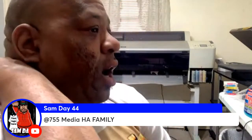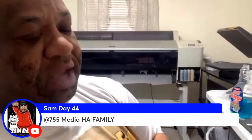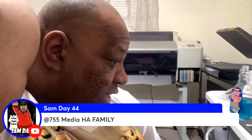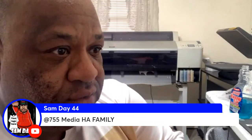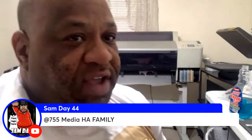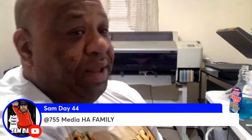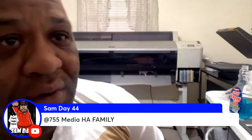One thing I like to tell people: make sure you have an extra set of cartridges when you have your printer. One thing I have noticed is that people have been running into a lot of problems with DTF when they print and don't have an extra set of cartridges, because you have to take these cartridges out to reset them and put ink in them. And if it's not reading, then you have to order another set of cartridges, which takes a while. And depending on the head that's in your printer, you don't want to let that ink sit up in your printer.